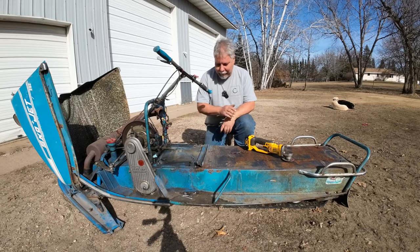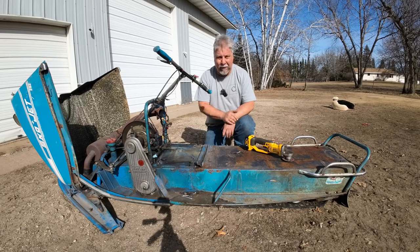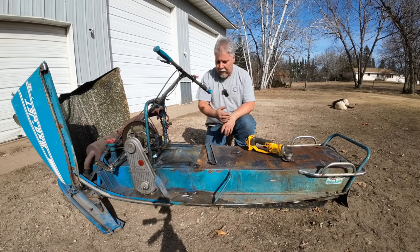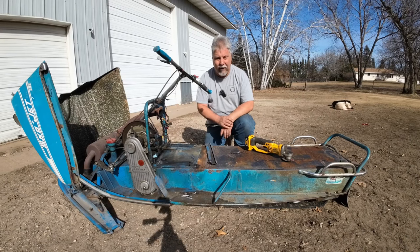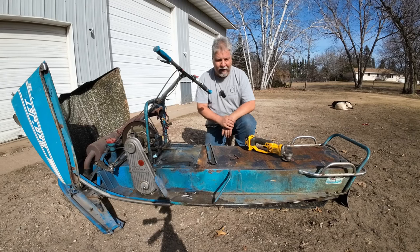So I knocked off this bracket — it was just holding on those two fiberglass covers. The one on this side kind of looked like it might have been intended to be a clutch guard, but by no means was it strong enough to be one. So we'll be making a real steel clutch guard structure over here that might actually protect a person. The one on the other side was just cosmetic and kind of in the way. We're going to do one-lung racing with this sled, and extra parts are just things to fall off or distract you when you're racing. I also nipped off the little brackets that were for the original Snow Jet seat — it'll never be going back on the sled since we're doing the XCR seat and the plastic gas tank.